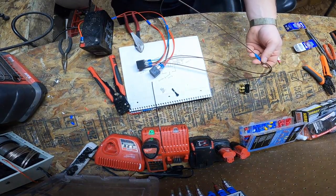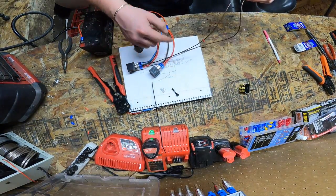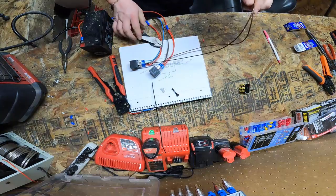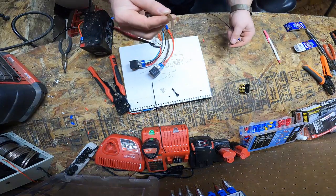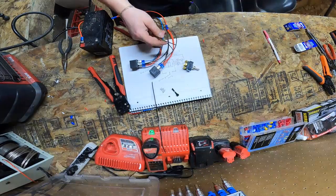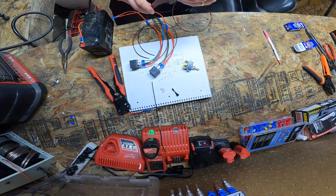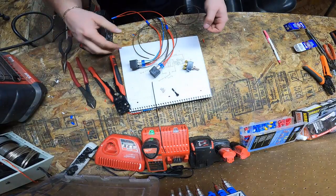Okay, so disregard what I said before. I don't know why I connected the two 85s together, but since you have the two separate wires, if you did what I did, 85 and 85 on each relay are going to be separate. They're going to be going to the switch. This end, which if you did what I did, you already have connected to the ground, is also going to be going to the switch. So let me fix that mistake.